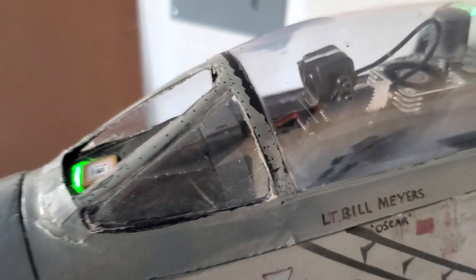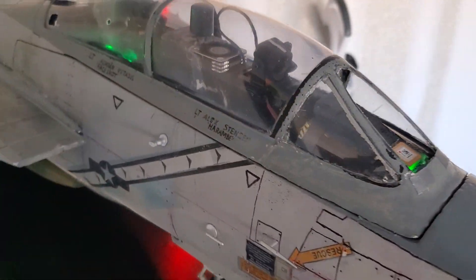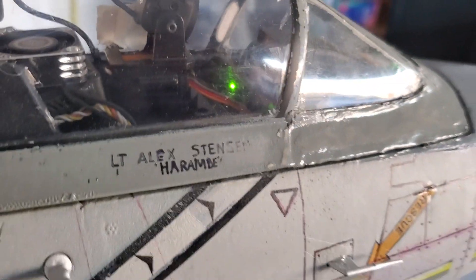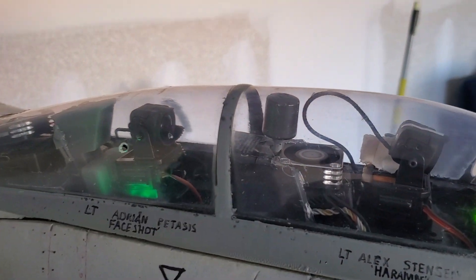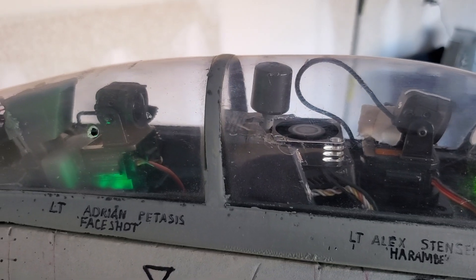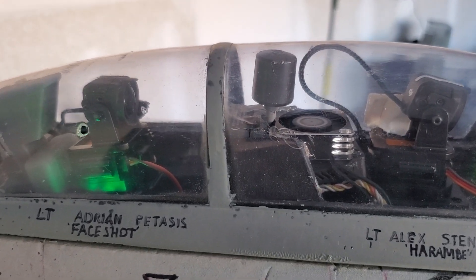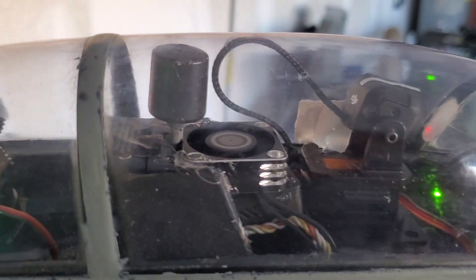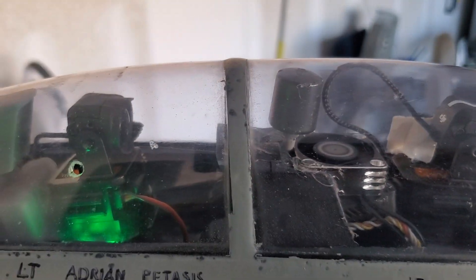You've got your airspeed and altitude display on the DJI-O3 with no flickering. We also have a landing gear position light — a recent install — that tells you what position the landing gear is in, so if you get a little behind the plane coming in to land, you can see whether your gear is still up. Right now the jet isn't set up for max range, so you get about a mile of range with my current setup, but you can easily push this up to six miles of range if you have an Arduino or a flight controller, which I'm planning on adding soon.